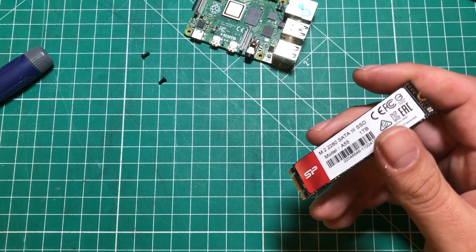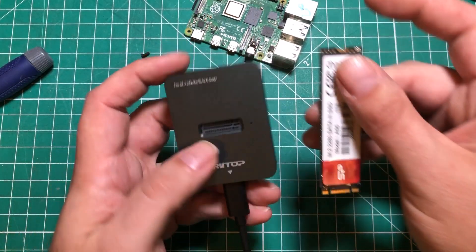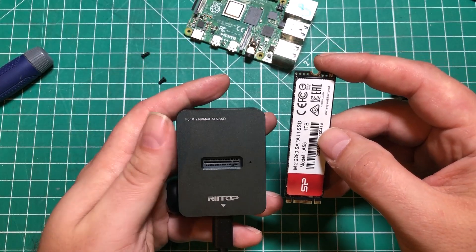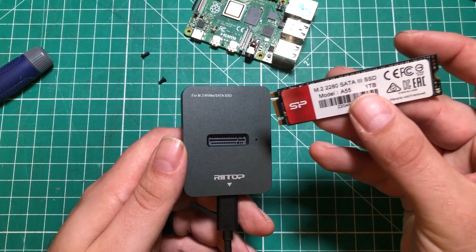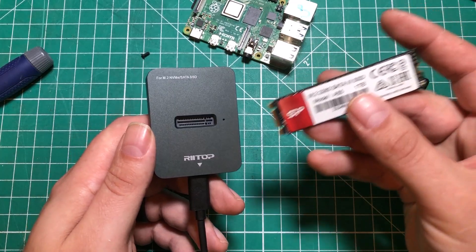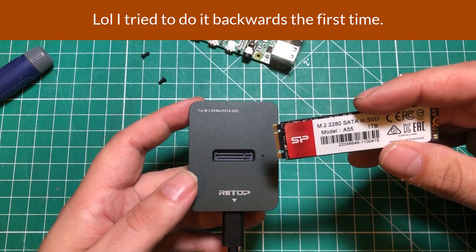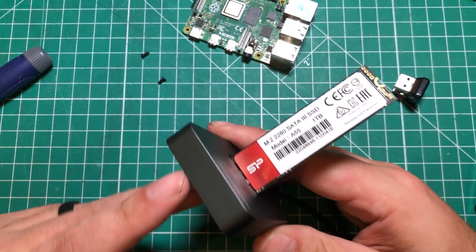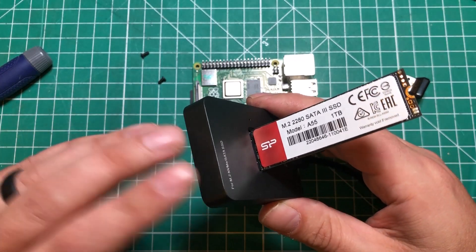I want to show you one other thing I really like — the R2 Top M.2 reader. For those of you who aren't familiar, there are two kinds of M.2 SSDs: NVMe and SATA. Not every reader can read both, but this one can. The Raspberry Pi case requires a SATA SSD, because you will not saturate an NVMe drive — it's actually running over USB, and although this is 30 to 40% faster than the fastest micro SD cards, adding a true NVMe drive would not make it faster. This uses B+M keying. I use this for transferring images and all that kind of stuff — you don't need it, you can transfer the image using the Raspberry Pi itself, but it's pretty sweet. I'll have a link in the description.